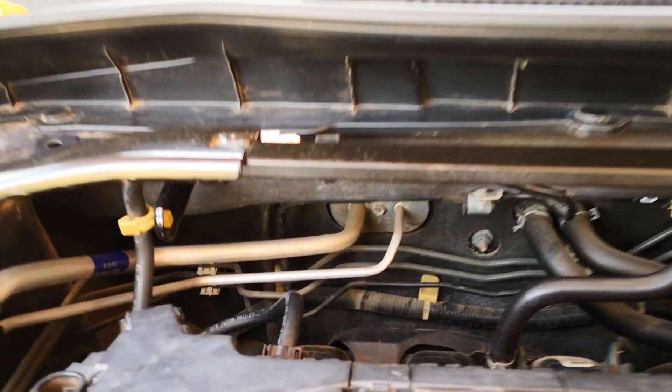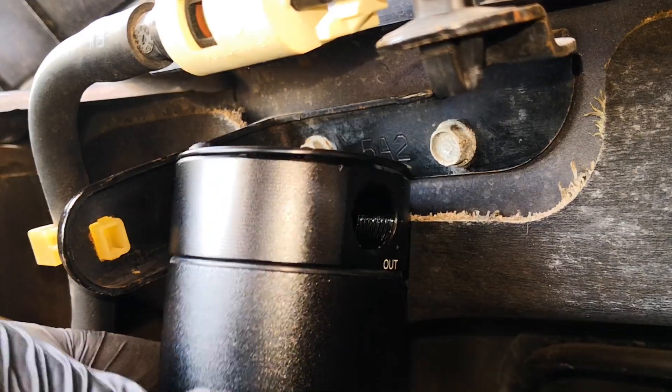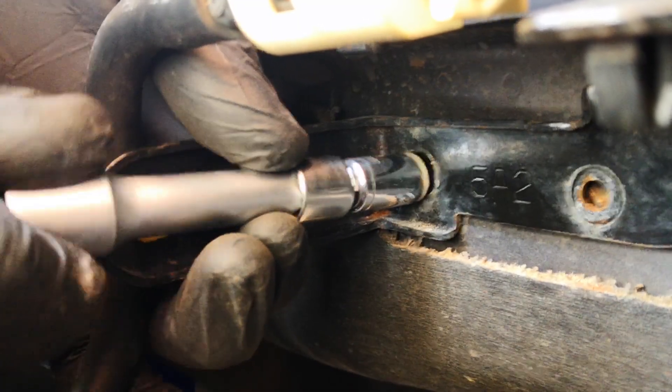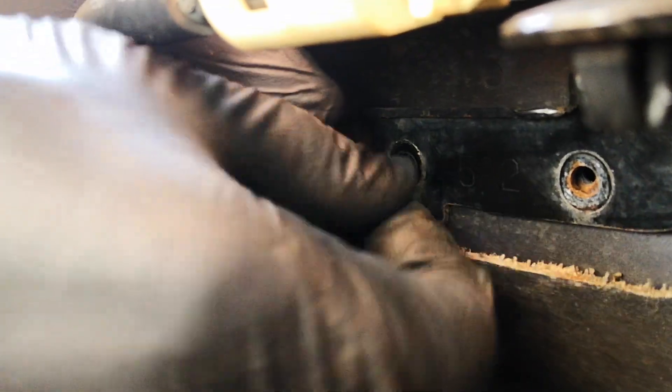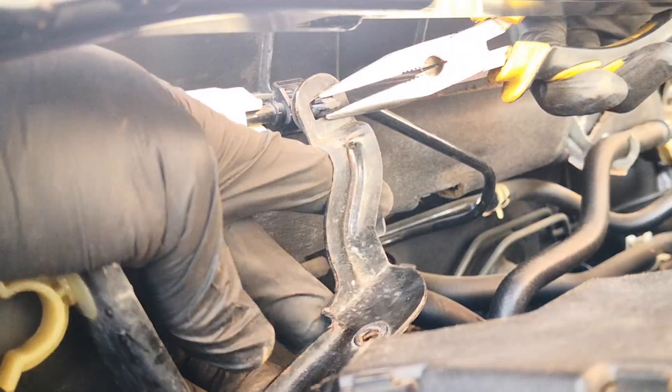On this 2017 Accord, I've been installing the catch can on this bracket which is mounted to the firewall on the intake side of the engine. The location on your engine might be different, but the most important thing is to choose an area away from the exhaust manifold or other hotter areas. If installed in any of those hotter areas, the condensation of the oil will be limited and you won't get the best out of installing an oil catch can.